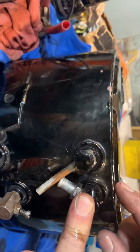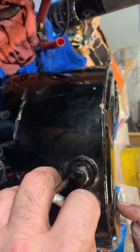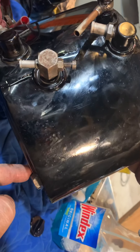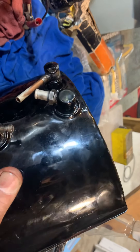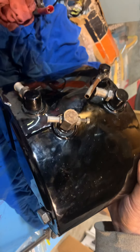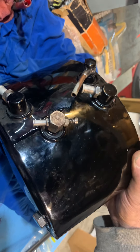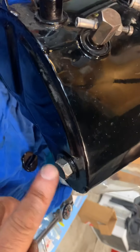The return fitting in those tanks has the same action where it dribbles into the chain oiler. But now the tube comes over and points right into the top of what I call the toilet paper tube — that's inside the fitting here, and that's what this sucks out of. So even if the bike is laying on its side, you're going to get some oil that rolls into the toilet paper tube and rolls down here and hopefully gets a little oil into your bike. Usually when your bike goes down you cut it off, so there's usually not a whole lot of force on it anyway.